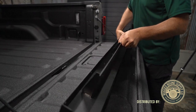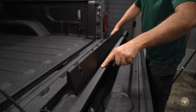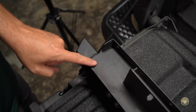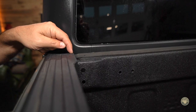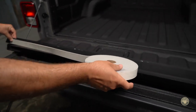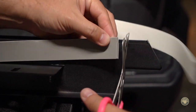This install will start with the hinge chassis. Flip the chassis over to the opposite side from the hinges. We will be applying 3/16 foam strip just to the weld edges on each end to match up with the bed sides. This foam strip will seal out water from the front edge of the bed.